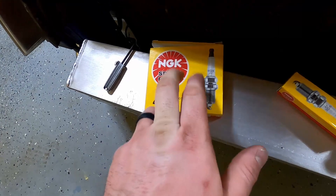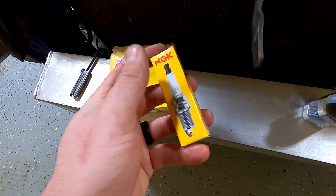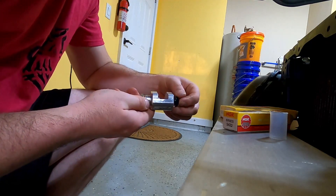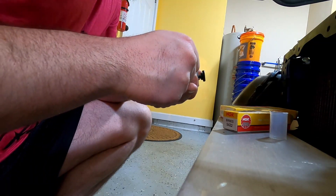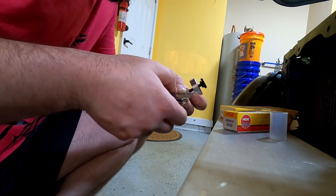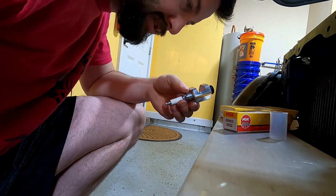I've already got three of them. I just wanted to show you guys what these come from out of the box — I've seen them range from 0.028 to 0.024. I just have a little spark plug gapping tool from STM; had the extra cash and got it, and it's by far one of the best things I could have gotten. Trying to run a 0.020 and right off the bat this one is a 0.028 — seemed a little loose.